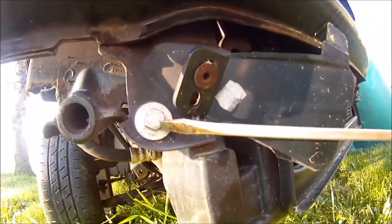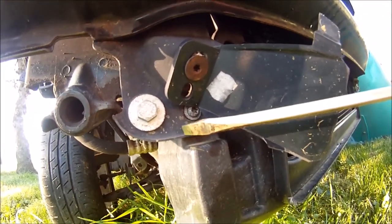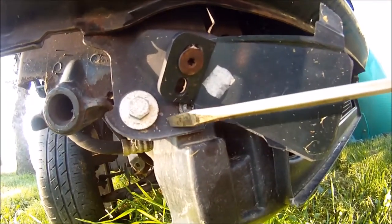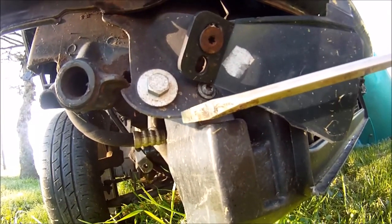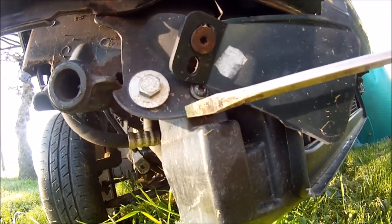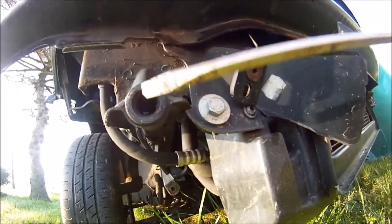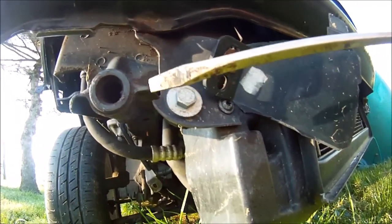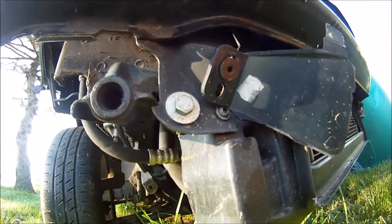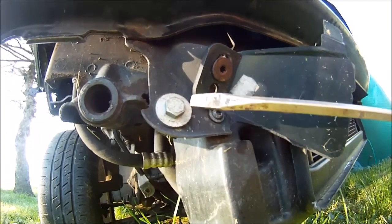And then over on the other side, you just remove this bolt, and then take a hammer and flatten this ridge out, or bend that back just enough for the 1/4 inch plate to sit tight against this. You could grind it off too, but with the bumper on, it's just easy to whack it with something. And like you saw in my car, my tow point is rusted in where I can't get it out, so it just stays in there, and the light bar works just fine with your tow hook installed. It should rest right up against there fairly snug. So that's it for that.